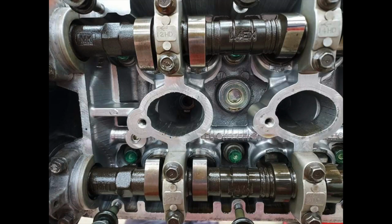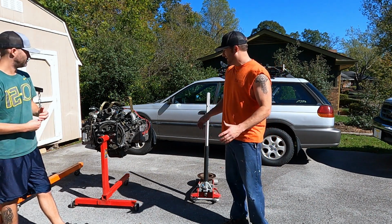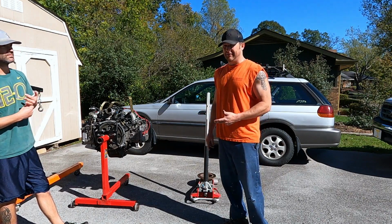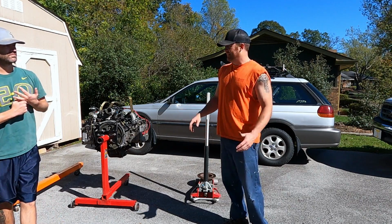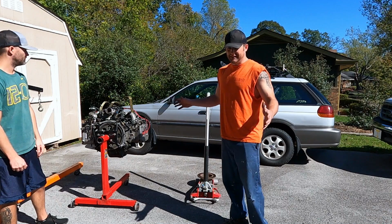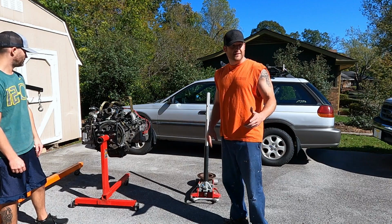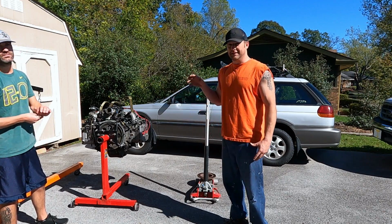But what happened, a quick breakdown, is I got the motor out of the vehicle, back into the garage, and was looking over some things. I'd done a compression test before we took it out, and a leak down test in the garage, all those things. The timing marks were lining up, so I was baffled. Researched online, couldn't come up with anything, changed manifolds out, still didn't fix the issue, and finally I took the valve cover off on that side where we had two dead cylinders, and I seen two markings on the cam, one for the intake cam and one for the exhaust.